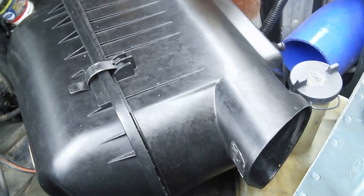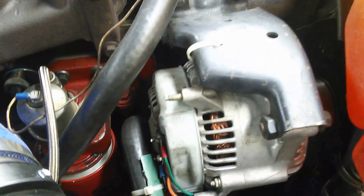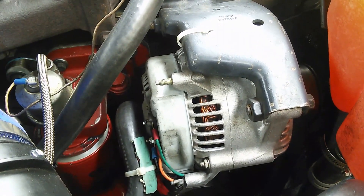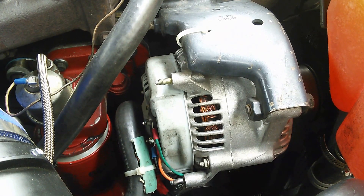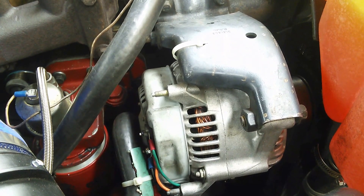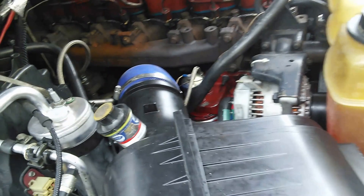That's my Cummins or Chrysler alternator — I did the one-wire conversion on it and I think it was $50 on the internet. My lights don't pulse anymore. I'll see if I can find the part number and post that up — that's a biggie. I've tried the different regulators from Ford and Dodge and my lights still pulsed, but this fixed it.